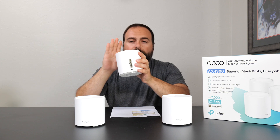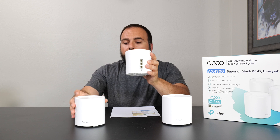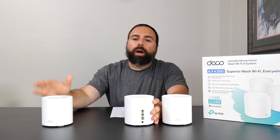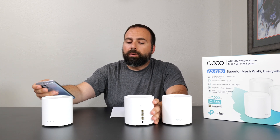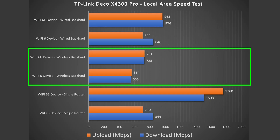Now jumping to wireless backhaul — this is when you have your main unit hooked up to your modem, or in my case the server, and the secondary is one or two rooms away, about 40 feet away, wirelessly talking to the primary. When I do the speed test I'm doing it from the secondary unit, which jumps to the primary and then goes to my computer as the server. Looking at the results, we can see there is a reduction in speed. However, considering this is a dual band system without a dedicated backhaul band like you'd get in a tri-band or quad-band, this actually did fairly well.